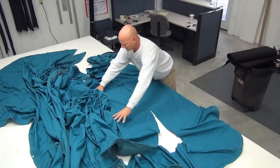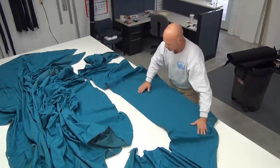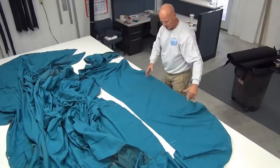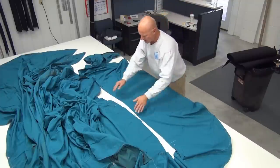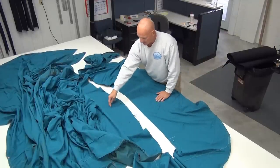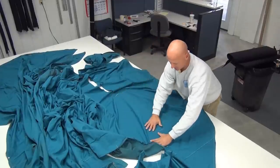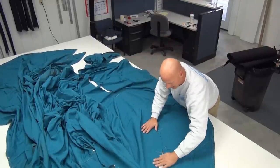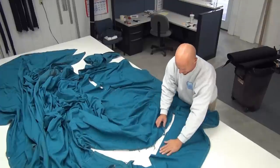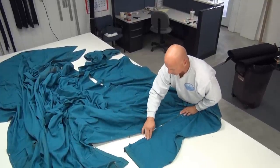This is the front of the cover. And this piece right here is what came over the top of the windshield. And what I've done, there's a center seam here that connects these two pieces. What I've done was I made sure that I scribed on this piece of canvas a line. And before I cut this out, if you can see this, I put reference marks, lines through this thing before I cut it out, okay? They go all the way down.